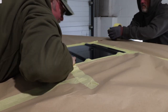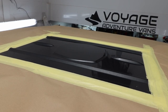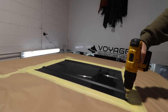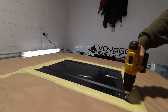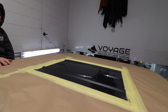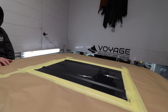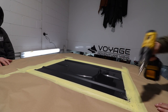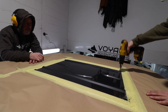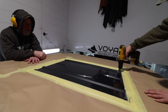We've just finished the masking of the paper. Now in the holes that we've got — which are 10 mil inside of the corner — we're going to start the corner off with a 20 mil cone drill. Each corner is opened out to about 20 mil. We're then going to come in with the jigsaw with just a standard metal cutting bit on it and carefully follow the line of the masking tape.